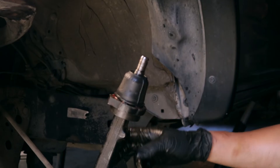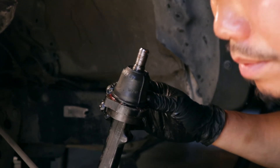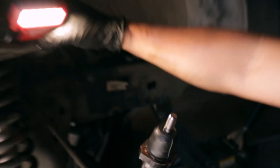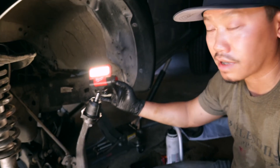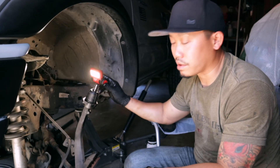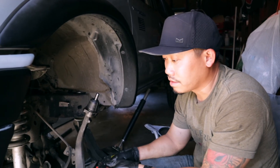There you go guys — I just used my hand and you can tell it slid in pretty easy. The boot's installed. Afterwards you just put it back together, make sure to put the nipple in at the bottom, attach it to your upper control arm, and tighten everything down. Don't forget your cotter pin and tighten it to specs. That's about it — it's pretty easy. I struggled the first time but we're good now, so thanks for watching.